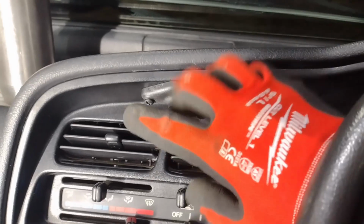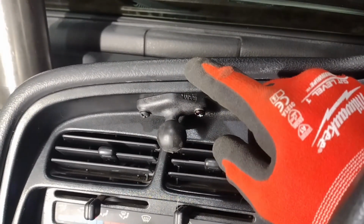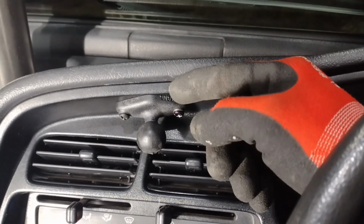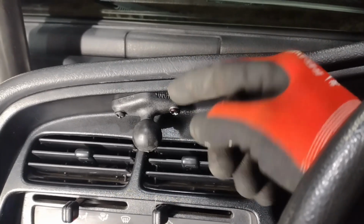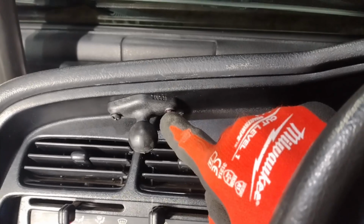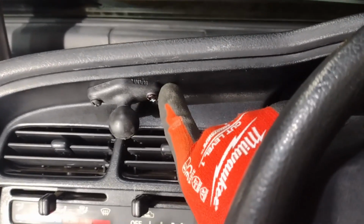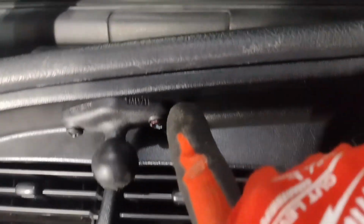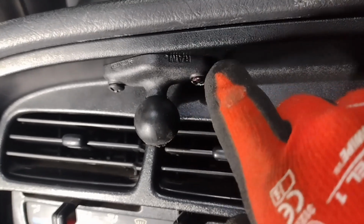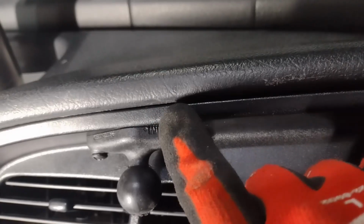This part was a real pain in the rear end. This dash goes in, then it curls back out or S's back out, and it catches this lip. So for this screw here, I had to notch that out because it wouldn't clear the top of the screw and the nylon lock nut that's behind here. So you don't see any of it. It's all hidden back there.